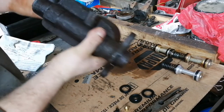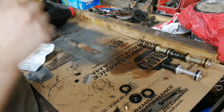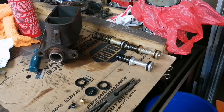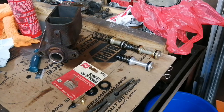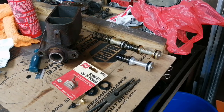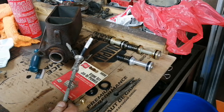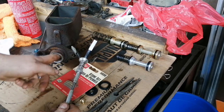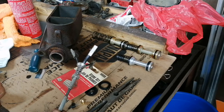That's full of crap. I'm going to clean this up a bit more inside because there's a lot of garbage in there. What I quickly found was, inside the bore after I cleaned all the dirt and slime out, the bore definitely had a little bit of corrosion — just a little bit of pitting, but that's enough to catch the lip of the seal and potentially tear it. So I got a brake cylinder hone here, which is meant for master cylinders and wheel cylinders. I'll put a set of stones on it and give it just a light hone inside to clean everything up, and then we can start reassembling the master cylinder.